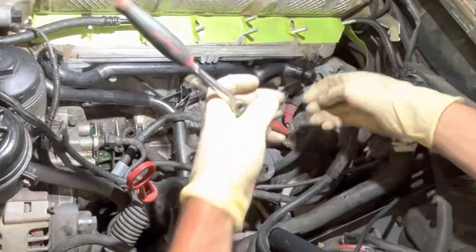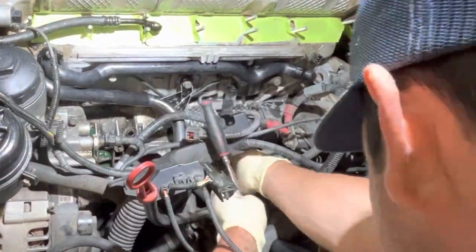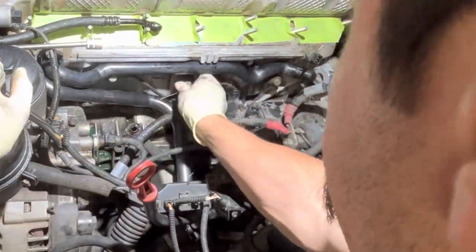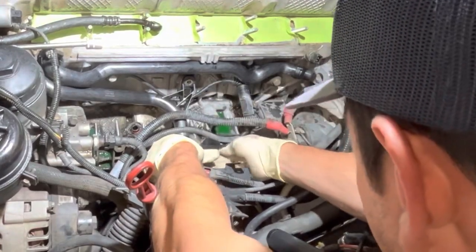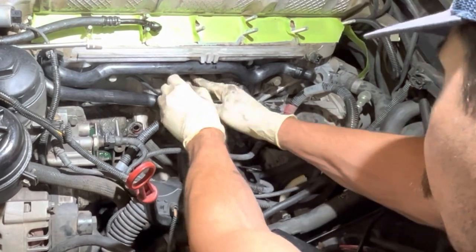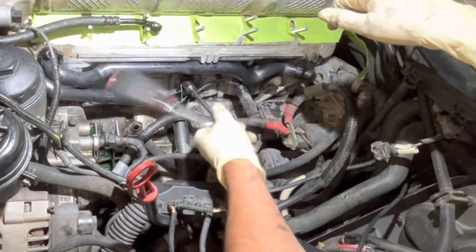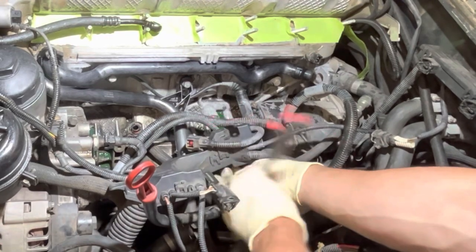Like I'm dealing with here, if you order aftermarket parts, you're bound to run into an issue or two. For me, these water pipes, the fitment was a little off from factory, so I just needed to play around with the two bolts, make sure I got both brackets lined up before I snugged them down. So just a word of wisdom, if you are going to save the bucks like I did and go with a Euro cooling system pipe and coolant hose kit, just be aware, sometimes they don't always fit as good as original equipment.